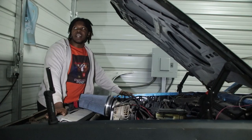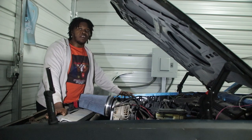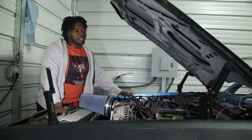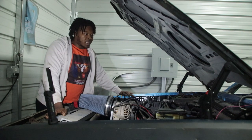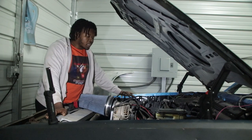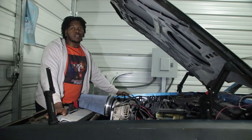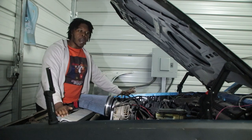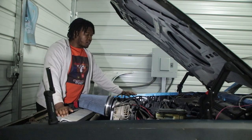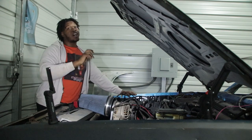Making progress on the G-body today, but we've hit a point where it's time to revamp some things. I gotta pull the intake back off this engine - I got an injector on this side that's stuck open, and it's still dumping too much fuel. I thought it was the cam sensor, which did stop the popping, but I still had fire. In the previous video it stopped popping, but as soon as I turned the camera off and fired it up again, it dumped all the fuel out.